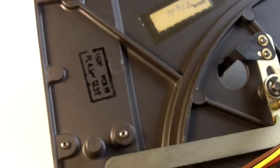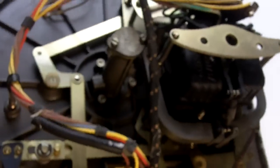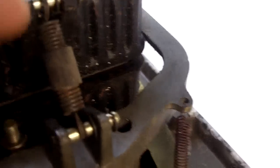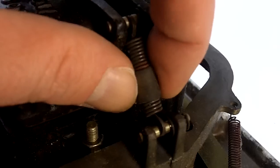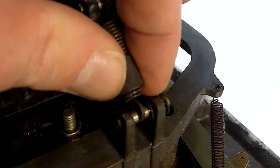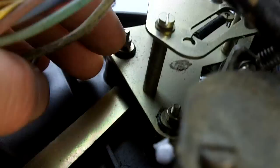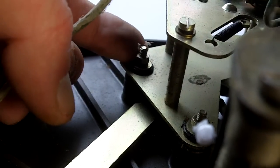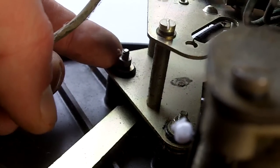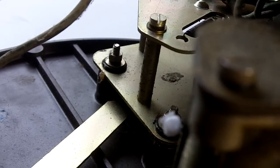So if you're thinking of buying a Garrard 401, some of the points to look for, if we go back to the original rather sad unit over here, some of the points to be looking for be corrosion, or in this case corrosion to the springs, but also the dryness of the supports and indeed the rubber dampeners here. We'll be looking over in here in this area to the idler housing grommets to check what condition they're in, and I'm afraid they're very dry and brittle in this case.